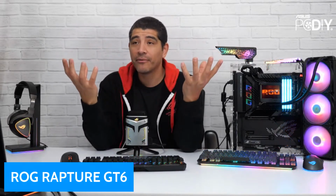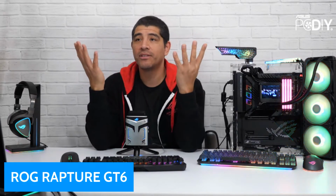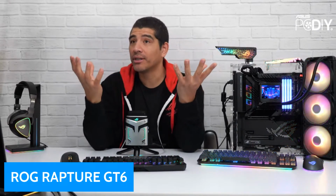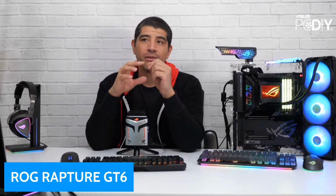A traditional high performance router with a very high performance antenna design could cover even a two-story house. Take, for instance, here, I'm in a home that's 2,600 square feet, and I can cover the entire house with one router. I don't need a mesh networking product. So it's not accurate to think you have to have mesh just to have broad coverage. Where mesh really helps is in really big homes or in what are called last mile scenarios, like the last room in the house, the backyard, the patio, another space, or ultra dense environments.